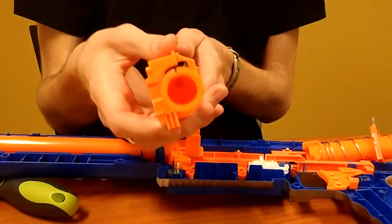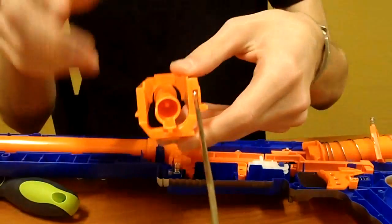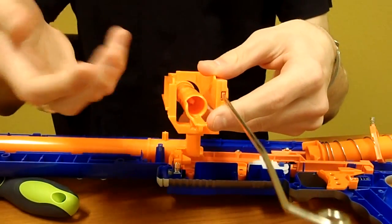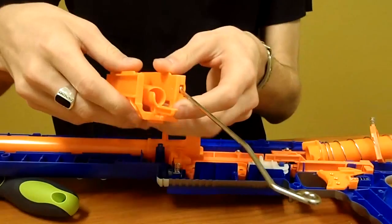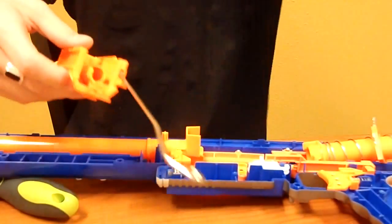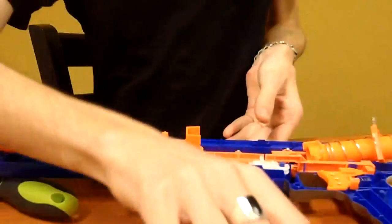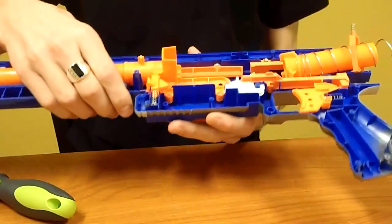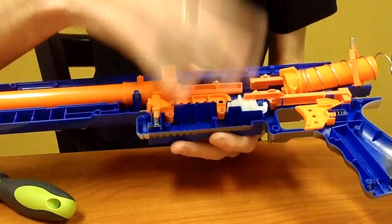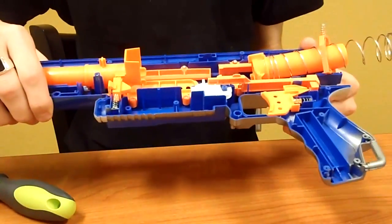Now see here how there's an air restrictor still in here? I'm going to take this out with a combination of my Dremel and hammering it out. You can also use a drill or brass. There's all sorts of ways to cut this out. But I'm going to do that and remove the clip lock and remove this door here because I hate the jam door and its lock, and to remove that you take these 4 screws out and just lift the piece out. But I'm going to do all that in a second and show you when I'm done.